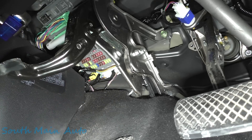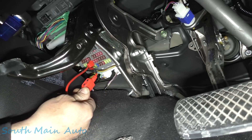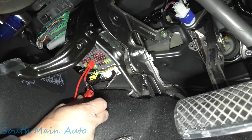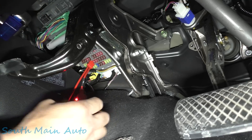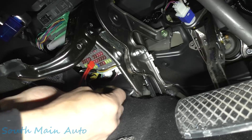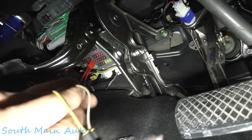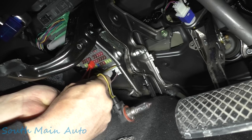I think I grabbed a couple different fuses here. This takes a regular fuse. The red LED on this indicates it opened. I wonder if we should be smart and just stick a circuit breaker in here so we're not blowing through fuses, or we can even stick a test light in there. Let me grab a test light. It's a 20 amp, but we're just going to briefly touch it. It does make some clicking there. We don't know the circuit design yet, but it's a 7.5 amp circuit, and we've got a 4 amp bulb here, so we should be okay.